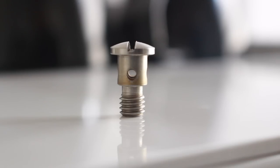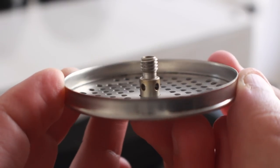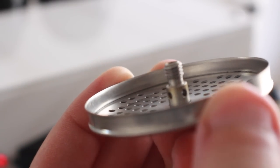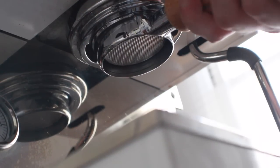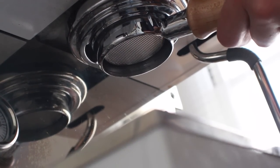The design of the dispersion plate varies from manufacturer to manufacturer, so I recommend you take a look at yours. On the La Marzocco, this isn't really a consideration — all the water is dispersed through the center into a hollow screw that pushes water out in four separate directions over the screen. Based on my experience, screen alignment is a possible but unlikely source of extraction issues, especially since screens move and drift during regular use. I wouldn't worry much about it unless your troubleshooting takes you all the way there.